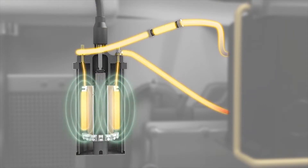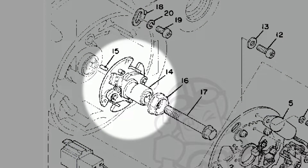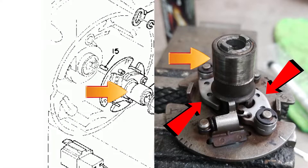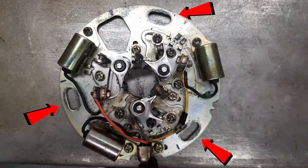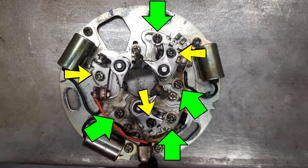It seems like there's a lot going on, but this all happens literally in the blink of an eye. Now that you've got a grasp on the principle, let's take a look at the assembly. In the center is the governor wheel. It's bolted to the crankshaft and has the timing marks on it. It also has advance weights and a cam that operates the points as the engine turns. The points are bolted to a frame that has slots to adjust their position in relation to the spinning cam, and that's actually what times the ignition. There's a bunch of adjustments and screws on that plate that we'll cover later.